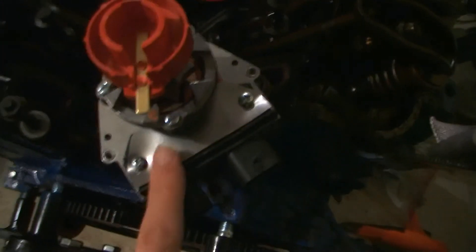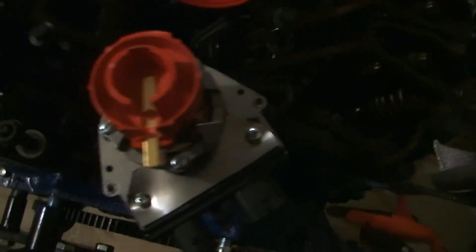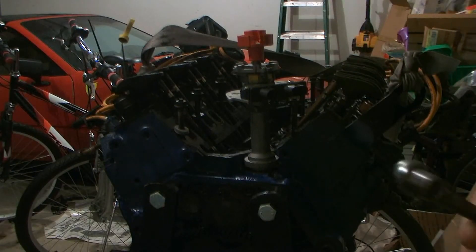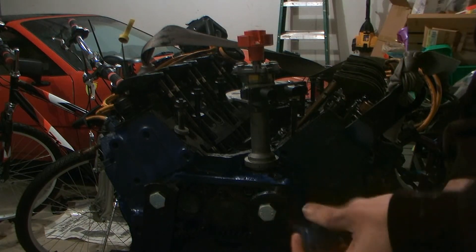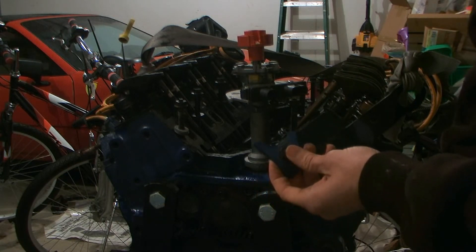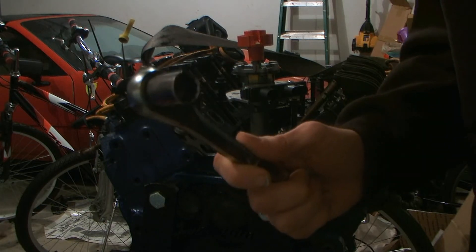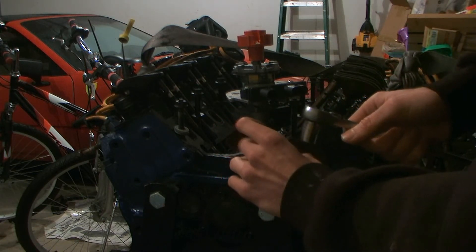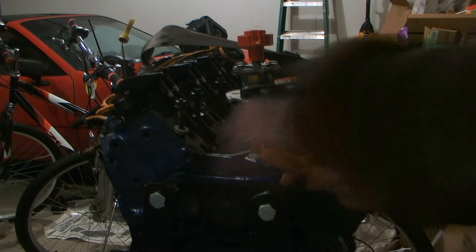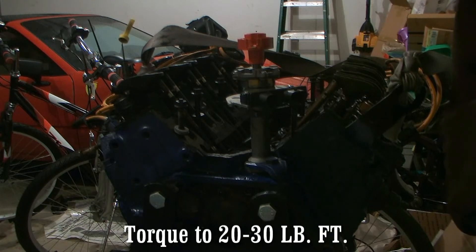A little closer up, you can see the distributor. There are the points, and there's the marker that the A1 Cardone has. And if you look dead on, it's spot on. And the last thing you'll do, once you get your distributor in and set, is take that clamp we removed from the cap — we're going to reuse that to hold down the distributor. That uses a 15 millimeter socket. Set that in and get it clamped down so it won't move. And there you have it — that's how you put the distributor in.